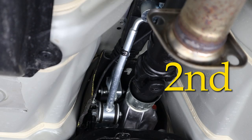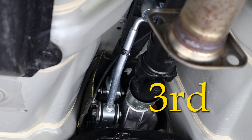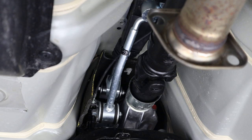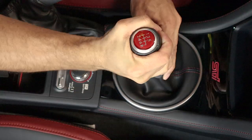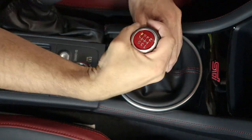All of this is relatively subtle, but here you go — it doesn't take much movement of the rod to change the gears. This is why you need that pivot point placed on exactly the right spot on the lever in order to get the throw distance that you desire. The shifter assembly in this car is removed from under the car, so before we get to all that fun stuff, we have to completely disconnect the shifter from inside the car.